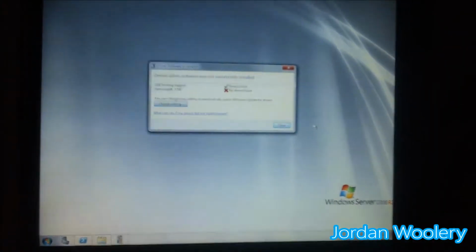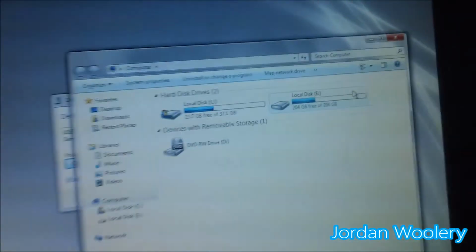And so, yeah, I think I got my storage drive installed correctly in that slot up there. I ended up having to push it back farther to make it reach the SATA port. And now, as you, whoops, dang it, get out of my way, control panel. But as you'll see, whenever this control panel window gets out of the way here, I did, in theory, get the drive to detect and install in Windows, so I'm going to format that as NTFS, and I'm going to set this up to be a file server, hopefully.